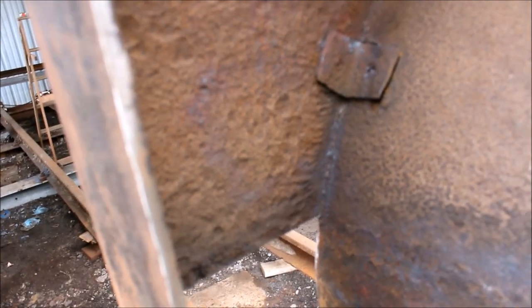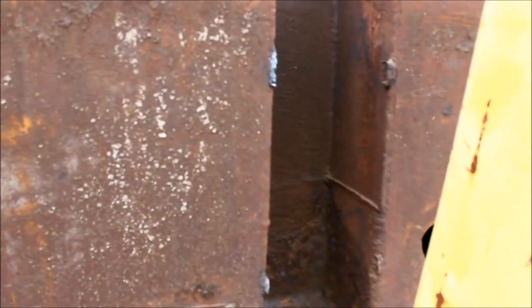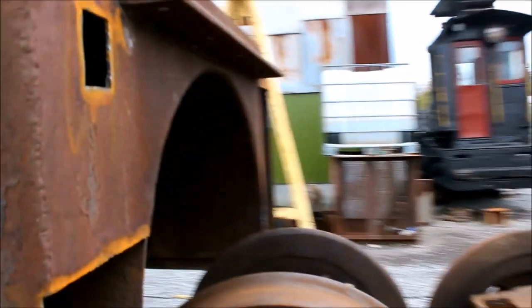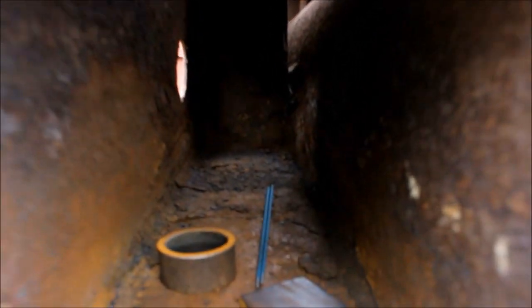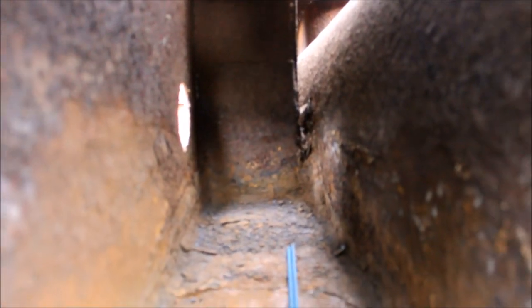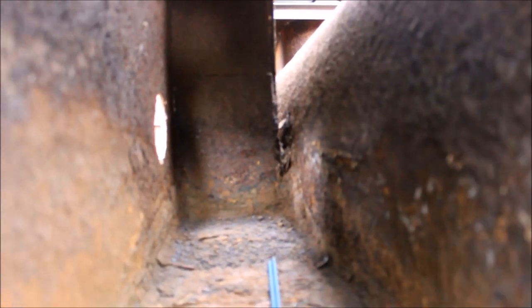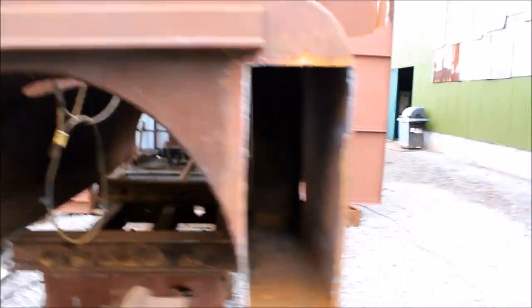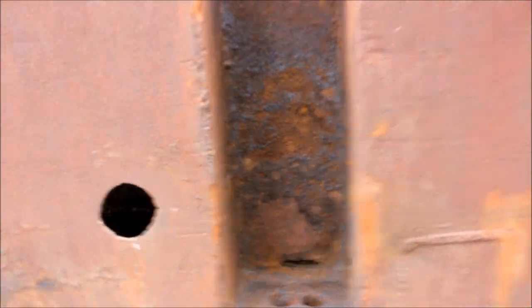This corner pocket was all rotted out, so we got rid of that. I've got four of these holes to close off. That shows what these pockets look like, and then of course we have what we've already done up front. You can see all that scale in there — that's hard to get at. All that stuff back behind the pocket in the curved portion does not come out unless you cut it all out and really chip at it. So I really have no choice but to pull these pockets out. Over here you can see how thin the wall has rotted through, so that one needs to come out too.